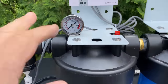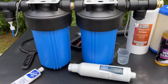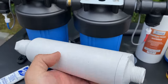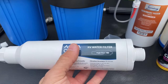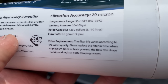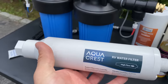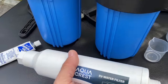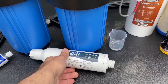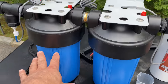This is Jerry's water deionizing filter system he took off his wall to bring here for the video. On the channel I've used inline carbon block RV water filters — they do help, but Jerry pointed out they only flow 0.5 gallons per minute. With seven gallons per minute coming out of my spigot, there's not enough dwell time, and a pressure washer needs at least two and a half gallons per minute — so that setup is not adequate.